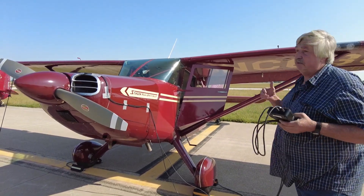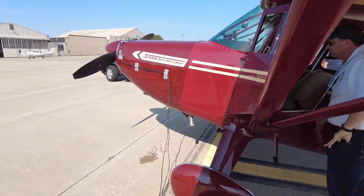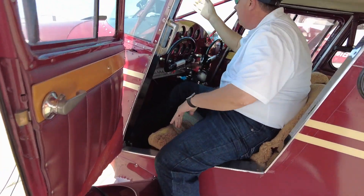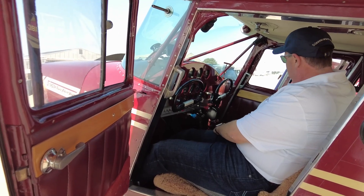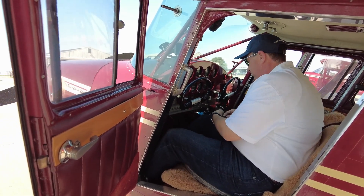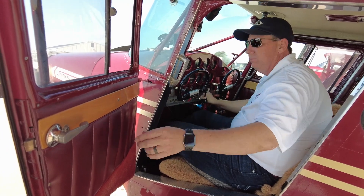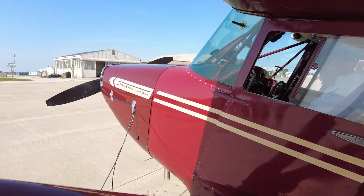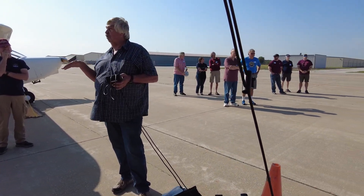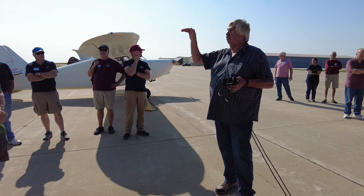We need everybody to stand back behind me, behind the wingtips, and we'll get Jody to run it up. The first thing he's going to do — it's already warmed up. He's going to run it at 2,000 RPM. If you've got an analog tach, we can check the accuracy of the tach with this equipment, because it gives you an exact digital reading of the RPM right down to the number. We'll do the trial balances at 2,000, get it tuned in with the weights, then run it up to cruise RPM at 2,400 and check the balance there. Sometimes we'll get them rough at low end but dead nuts smooth at cruise RPM, and that's what you're looking for — smooth where you're going to be sitting for hours and hours.